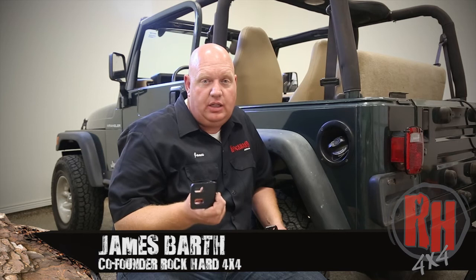The rear cross member takes a lot of strength. And what this does is when you brace it forward, it really eliminates any twist on that. And if you've got a CJ, you could be dealing with a 30-year-old vehicle, okay? So it's important to put this frame brace kit in there.